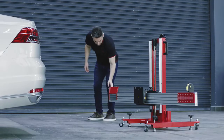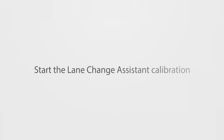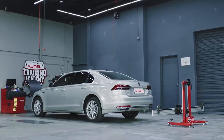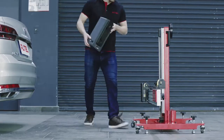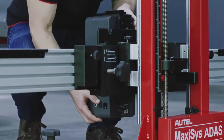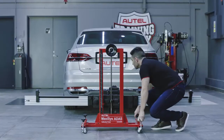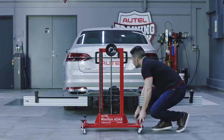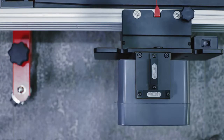Close the cover plates on the crossbar. Power off lasers on the attached wheel clamps and remove clamps from wheels. Start the lane change assistant calibration. Do not open or close doors during calibration. Attach the radar calibration box onto the sliding plate of the calibration frame. Ensure the radar box and the calibration frame are level by referencing the bubble levels on the radar box. Rotate the anchor bolts on the base of the calibration frame until the frame and box are level.